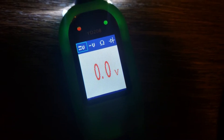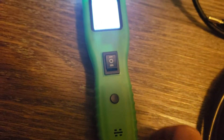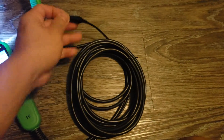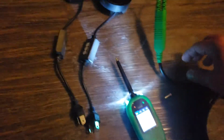Get the probe stick out here. Zoom in — there you go. We're on volts because we're gonna apply volts to that light. When you press up it applies power, and when you press down that means ground pull. I'll get my ground under here and connect the ground.